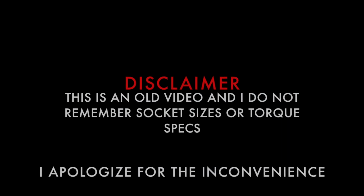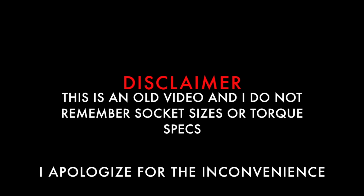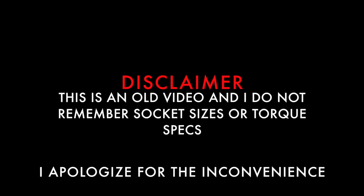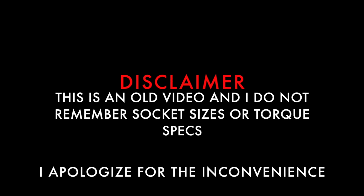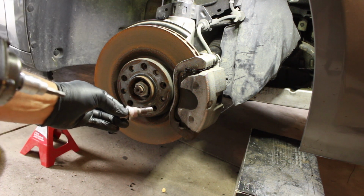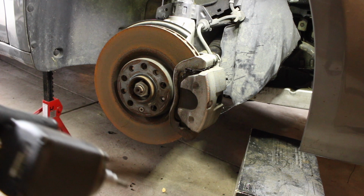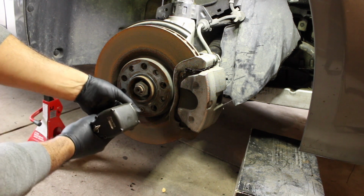Today we're going to be working on this Dodge Dart. Alright, so we're going to be replacing the bearing because Dodge, in its infinite wisdom, decided to put European style lug bolts on it, and someone tightened two of them too tight and destroyed the threads in the hub. So first I want to take this little guy out, which holds the rotor in.